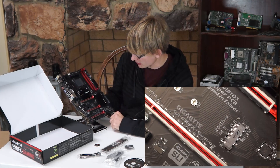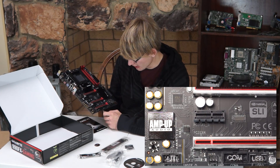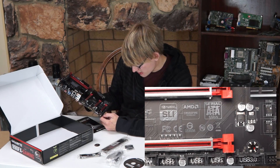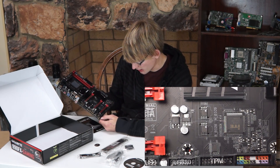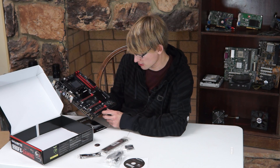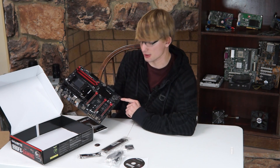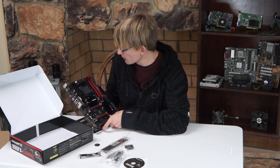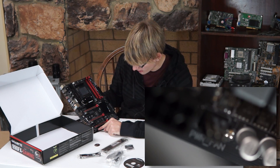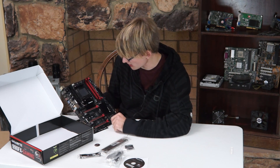It's got a black and red color scheme going — it really looks quite nice. It's got silver PCI Express shields. Looking down at the bottom, the headers include a serial port header if anybody still uses serial port. It does have a front audio header that works with both of the main audio profiles. It has front USB 3, front USB 2, and front USB 1 — so actually three USB 2.0 front headers, one USB 3.0 front header, and a TPM port, as well as all your front headers for your case connectors. Moving up, you have one CPU 4-pin PWM connector, one 4-pin system fan connector, a power fan, and a second system fan connector which is a 3-pin. Gigabyte likes to give you one PWM and one regular 3-pin, which is kind of annoying, but whatever.